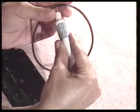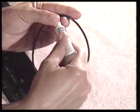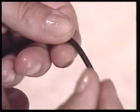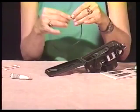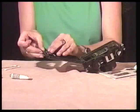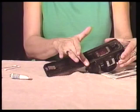To lubricate, place a small amount of the provided O-ring grease on your fingertips and rub it onto the ring. As you do, feel for any cracks or irregularities. After lubricating, place the O-ring back onto its seating, stretching it slightly into place. Before closing the camera back, run your fingers along the seating surface to check for debris.